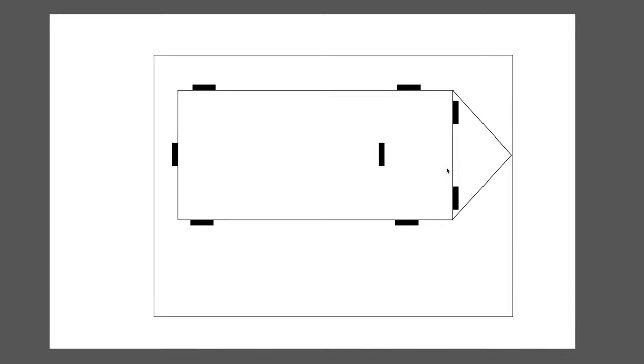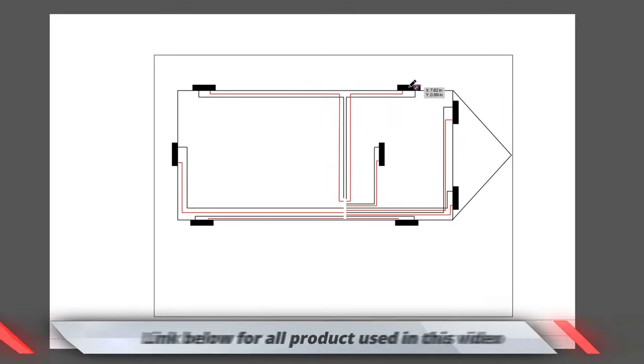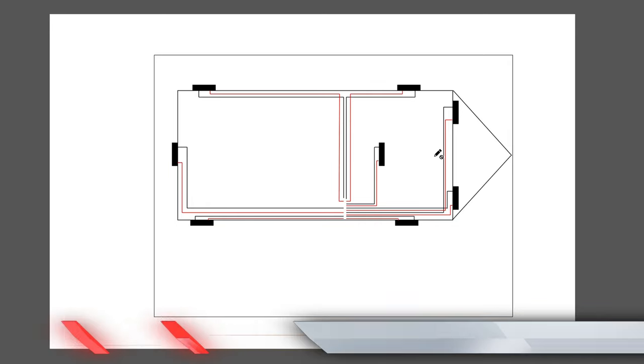All right, back to my drawing. Here is my camper from the top view. I have two lights on the side, two in the front, two on the other side, one in the back, and one underneath the camper. Each one of these lights has a positive and a negative feed. We have the positive going to the holes I showed you in the roof and the negatives as well. I used simple speaker wiring. There will be links below for the lights, the wiring, and most of the things I used in this video.